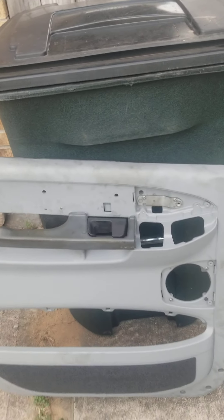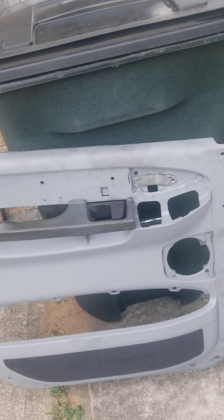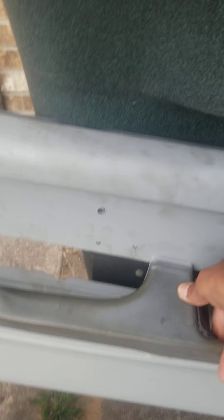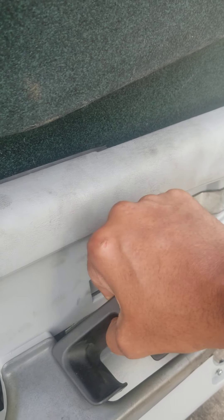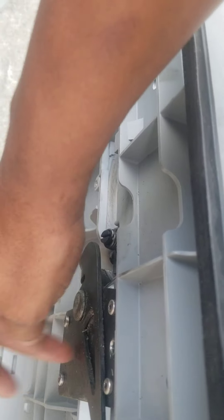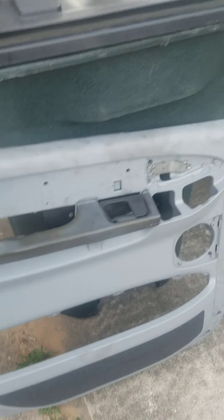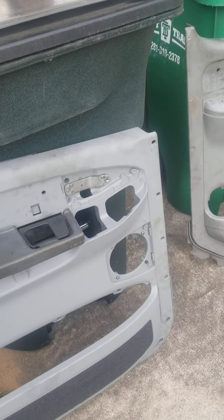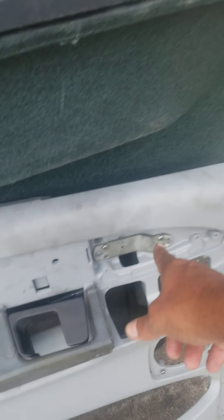So just wanted you all to see that. If you're having a problem with your Columbia, Century Class, or Coronado and the handle is giving you a problem opening, the culprit is that the inside is messed up — the retainer plate, and the Zerks in it have bust out of the door. You would have to buy a whole new panel, and that panel runs anywhere from $300 to $350 brand new. You also have to transfer all the hardware over from the old door panel to the new panel.